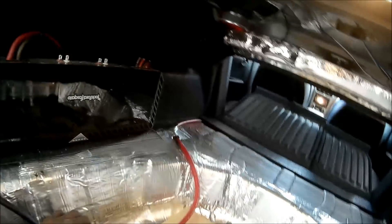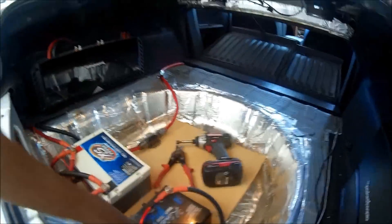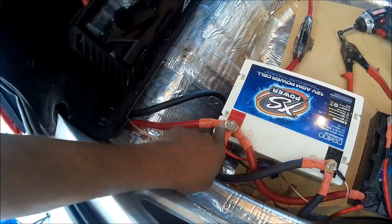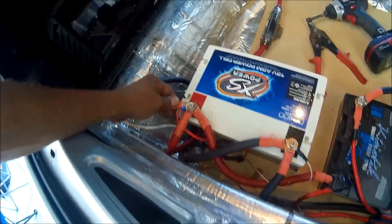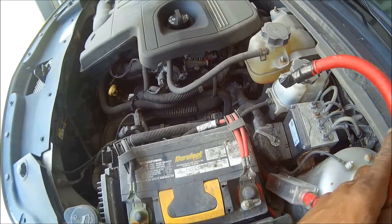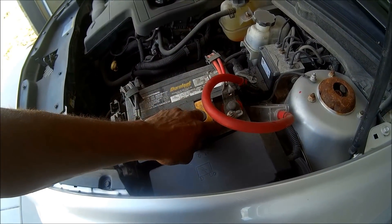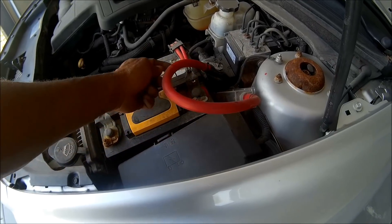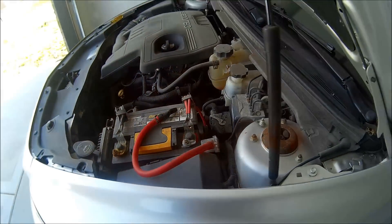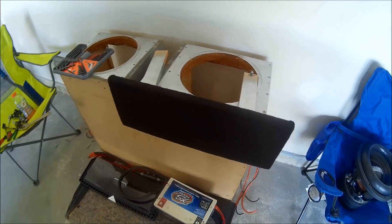Still one sexy amp, and I got a D2400 Kinetic. I went and disconnected all the power from up front. This was back in the days when I used to solder all my connections — drilling a hole and filling it with solder while the wire is on it. It works perfect when you have a low-power or high-power torch. Little nifty trick I used: clean the area real good, go through with nut, lock washer, and you're done.